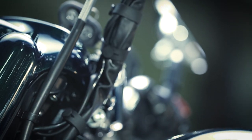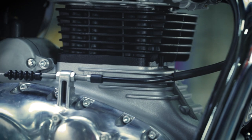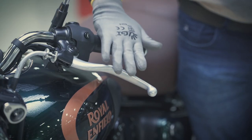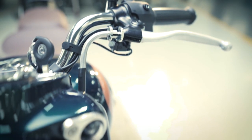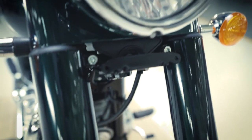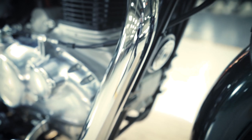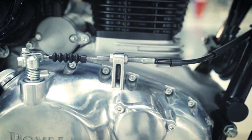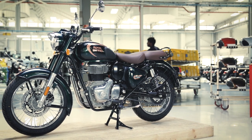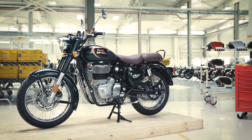First, correct routing of the clutch cable is very important for the motorcycle's performance. Ensure free movement and no stickiness of the inner cable in the cable sleeve. Always replace the clutch cable as per the maintenance schedule for the best performance. Remember not to wash or use any solvent for the inner cable. Always ensure that the motorcycle is in an upright position to ensure proper routing.